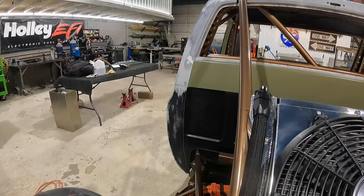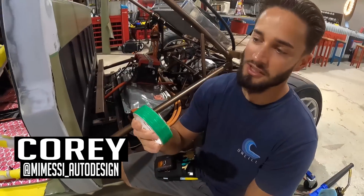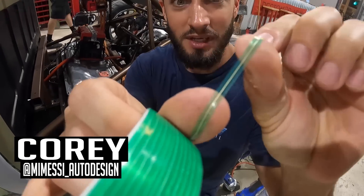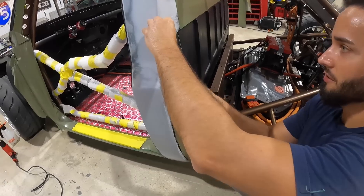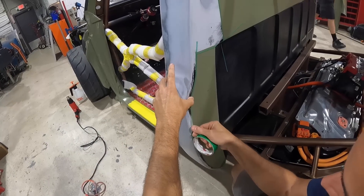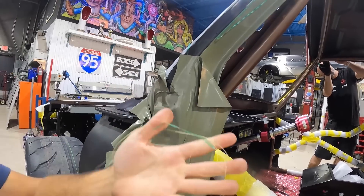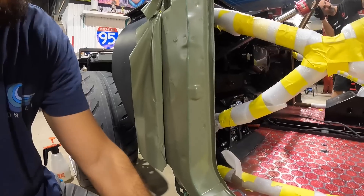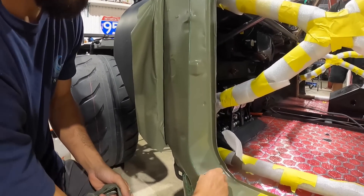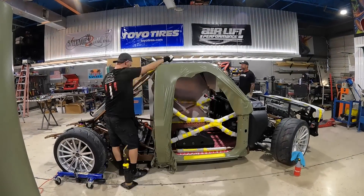This is something pretty cool so I figured I'd let Corey explain a little something about this tape. It's called knifeless tape — it's got this little filament, like a nylon filament. Anywhere you have vinyl film overlapping each other, you just go ahead and put it wherever you want. It gives you a really clean edge for those who aren't gifted with drawing straight lines. The other piece of vinyl comes over and you rip it — you break it, you get a nice pull, you're left with the string that was inside. You pull the excess off, get the tape out from underneath, and when you press it back down you're left with a seam that's clean, straight, and not very noticeable.